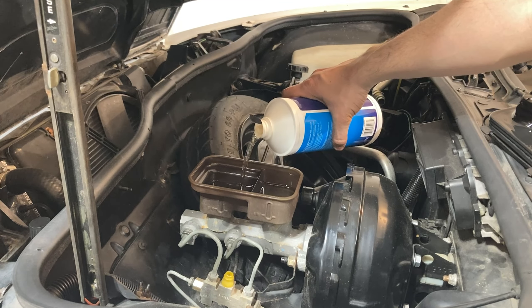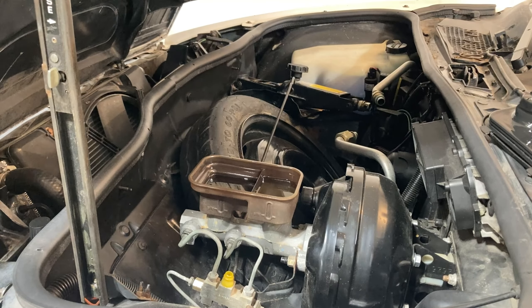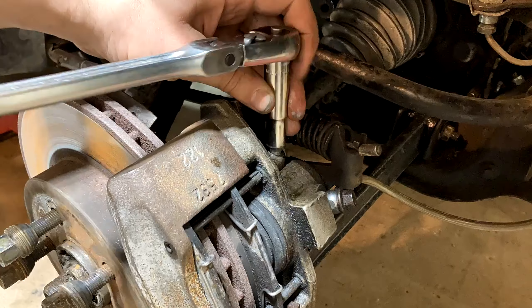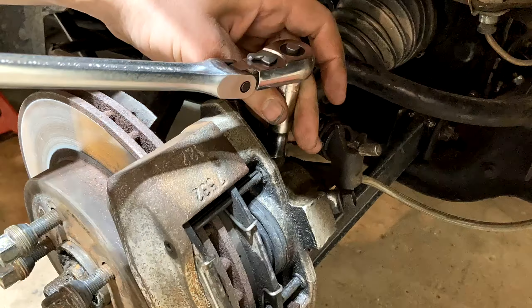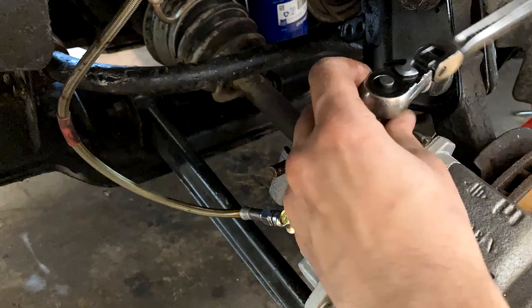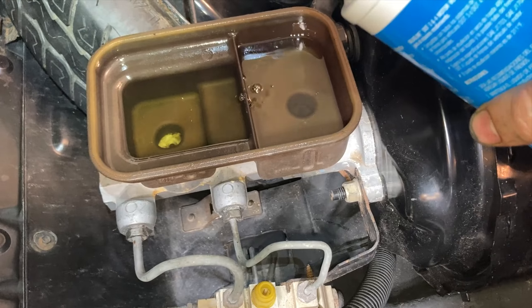On a Fiero, the furthest brake away with the longest line between the master cylinder and the brake is the driver's side rear. To bleed brakes properly, you will always bleed the furthest one away first. Grab a 10 millimeter wrench and open up this bleeder valve, and then have a buddy start pumping the brakes. Go ahead and loosen up the brake bleeder until fluid comes out, then tighten it back up again and have them pump the brakes again and repeat. You might want them to pump the brakes very slowly once you get rid of most of the air so that there's a little steady stream of fluid coming out. Then once they reach the bottom, tighten it back up and repeat. Then move to the rear passenger side, then up to the front passenger side, and then last move over to the driver's side front. Make sure you have your oil pan underneath because this will leak out a bunch of brake fluid. Try not to get the brake fluid on any of your brake seals. If you replace a lot of fluid in your system, you might want to refill your brake master cylinder every couple of minutes.